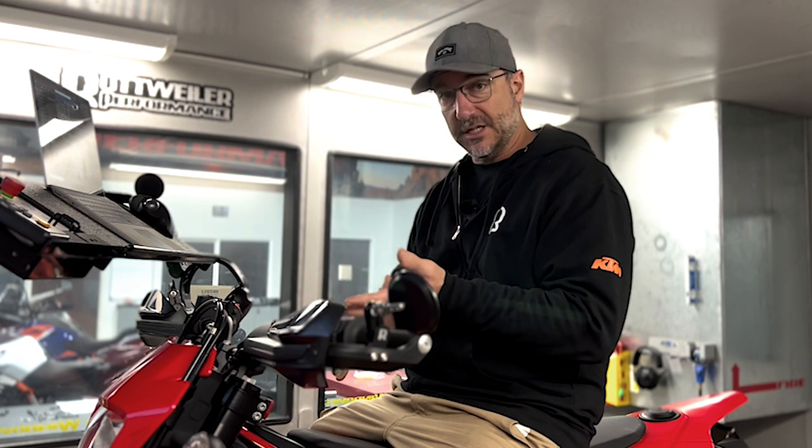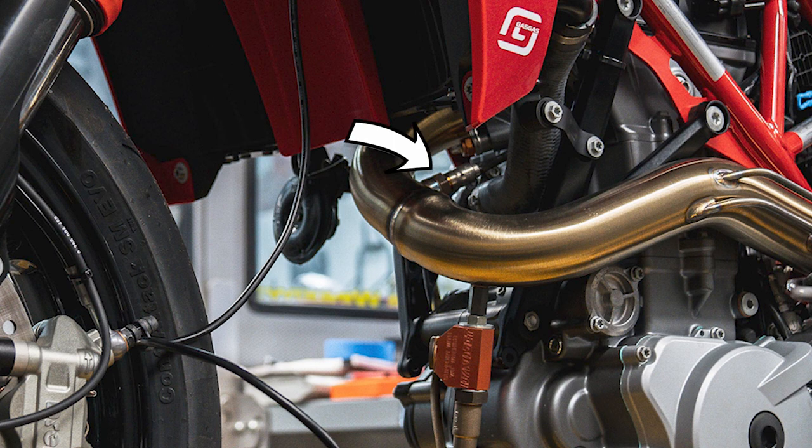Conversely, the 690s, the 700, this bike, and the 701s, they don't self-tune themselves. Now, they've got narrowband O2s, but they only use it to basically decipher whether this bike has traveled outside of its desired parameters, and if it does for long enough, it's just going to show you an engine light, which is essentially harmless, but that's really the only point of that O2 on this bike.